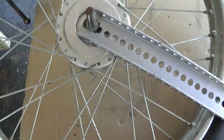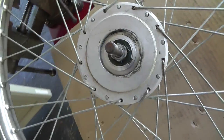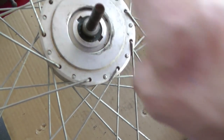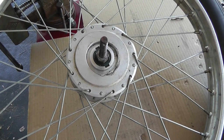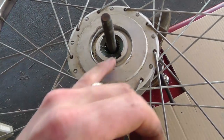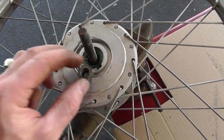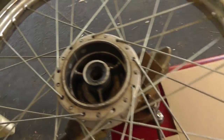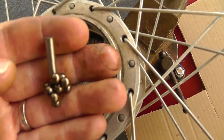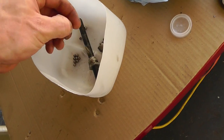I could not find a wrench that fits into this tiny slot, so I made one. Worked out really well - got that broken loose. Just loosening it up a fraction made it better, so we'll grease it up, check it, make sure it's all good. These are a standard bicycle wheel type bearing - the bearings float free, they ride on a housing and a race. It's pretty sketchy for the speeds I'm running, but I'll take these apart, clean them really well, and put them back together. I used a little magnet to suck them right out of there.